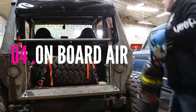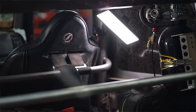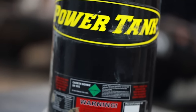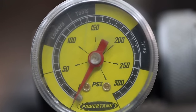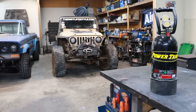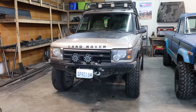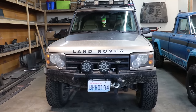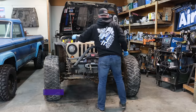Whether it's a CO2 tank, a 12-volt system, or something belt-driven, you need onboard air — it makes life so much easier. I believe there's a correct tool for every job. For filling four 40-inch tall tires on my TJ, I think that job is perfectly done by the Power Tank. You can turn it up to 250 PSI, which is way outside what a 12-volt compressor can do, letting you fill in a fraction of the time. For the Land Rover, I'm going with a 12-volt system since the tires will be smaller and you don't have to pay to refill — just click it on.